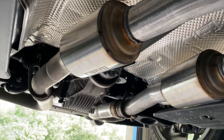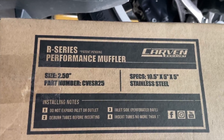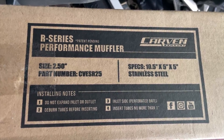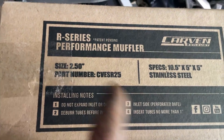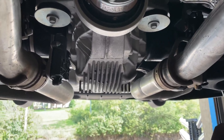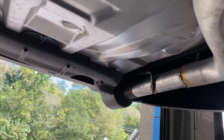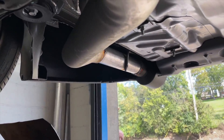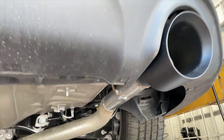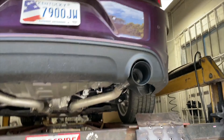Into some Carbon R's — part number R series, CVSR 25 — two and a half in, two and a half out, there and there. Then three inch intermediate pipes with the active exhaust, there and there. Then we did a rear delete — two and a half on each side — and then five inch black powder coated tips, because it fills it in.